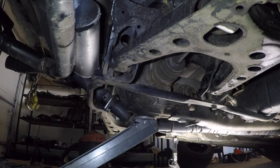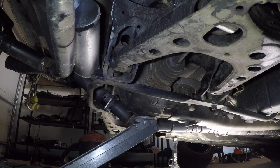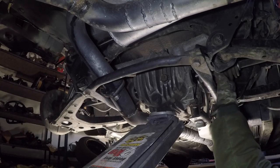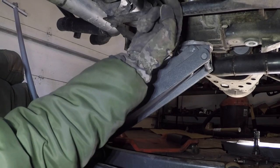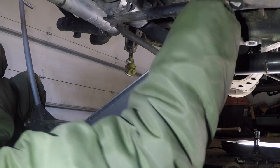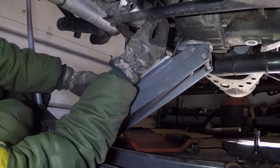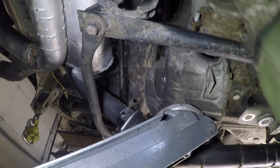I did not remove my exhaust, so that is going to be a pain in the ass, but we should be okay. I'm going to pull on the hubs, try and get these axles the rest of the way out. It got to a point where I couldn't get the CV axle out far enough by pulling on the hub to get the half shaft out of the diff, so I went ahead and removed all the nuts. Now I can separate the two, and with the two halves separated, you can move this out of the way and pull the half shaft.